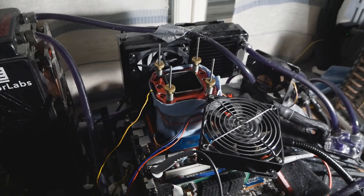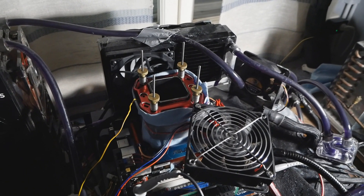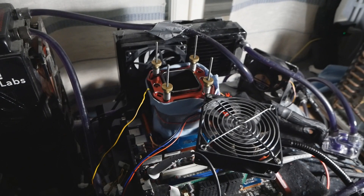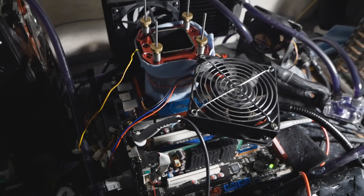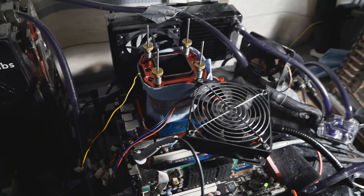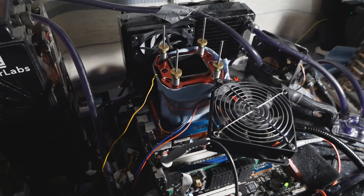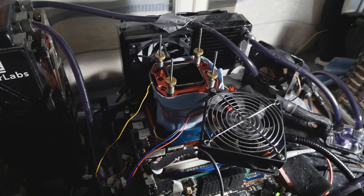The main issue with the E6600 is why you need to run such high FSB. I think we can stay somewhere around 500 FSB — the CPU should be able to do it, at least when it's on LN2. Not all of these CPUs can even run 500 FSB on air and water cooling. This time I'm using the P5 E3 Premium based on my knowledge and experience with the E6750, which is pretty much the same CPU as the E6600. I had a lot better performance with the P5 E3 Premium compared to the Rampage Extreme on the E6750.